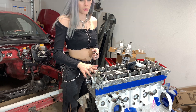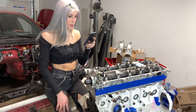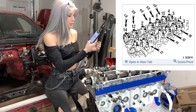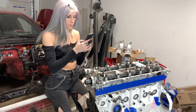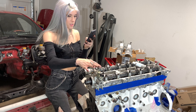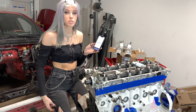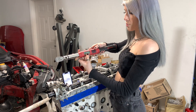Now these two caps are on there. Uniformly tighten 14 bearing cap bolts on one side in several passes in the sequence shown. 15 foot pounds is the torque spec for them. All but these little allen bolts which are 44 inch pounds. So I'm going to go ahead and torque these down. Get ready for the beeps - everybody loves the beeps. Now I've got my torque wrench set to 15 foot pounds.